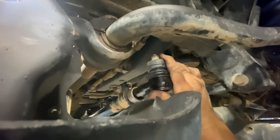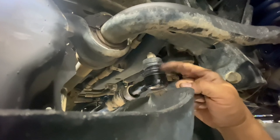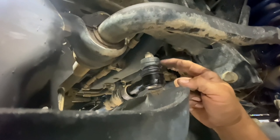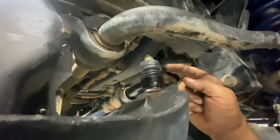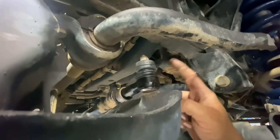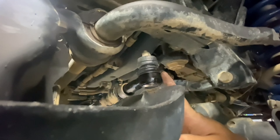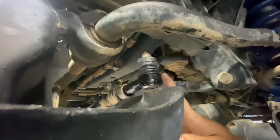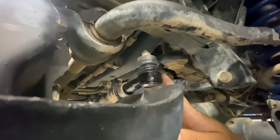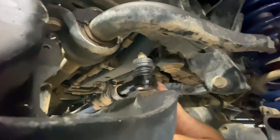You can put your arm on it while someone moves the steering wheel back and forth and you can feel the play in this ball joint — just going up and down. The socket was bad and all dried out on the inside. I have 15,000 miles on this Jeep, but I've been out to Moab, overlanding all over the Carolinas and Georgia. I ordered another Mopar part and put it on. If it breaks again I'm probably just going to go with Synergy.